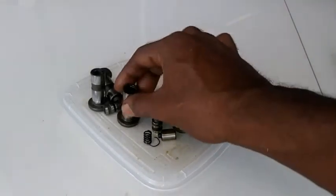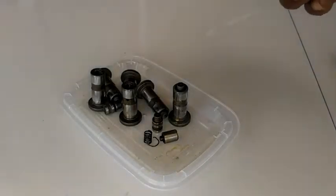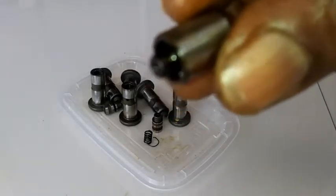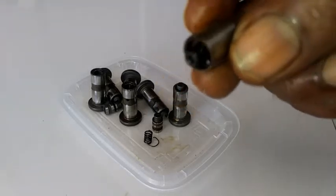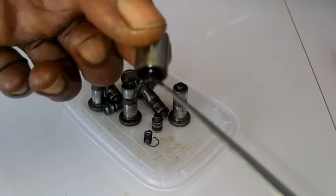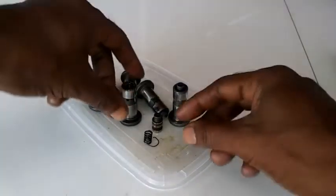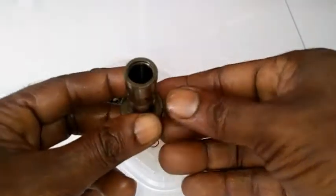The best thing for cleaning these lifters internally is to soak them in purple blaster. You don't want to use carburetor cleaner or brake cleaner. It's best to use the purple blaster because it really emulsifies the carbon and it's going to clean out where that ball and spring is down at the bottom — that's the most critical part. Once that area becomes filled with carbon, it's also going to restrict that ball from moving, preventing oil flow into the lifter. When reassembling, make sure the bottom is completely clean, removing all the sludge and carbon.